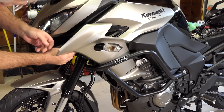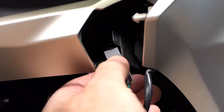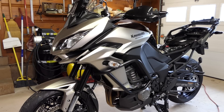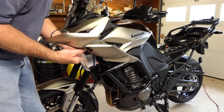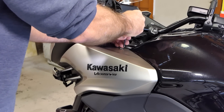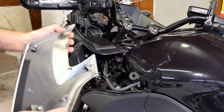We've got to unplug the turn signal connector here. It's got a little push tab — we push that in and pull to release the connector. With the wire unhooked, this panel will come out over the bars. For the upper fairing panel, it's pretty simple: one screw, then push pins and grommets — a clip here, a grommet there. We just pull it off.